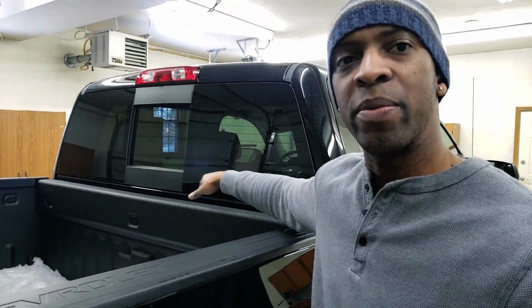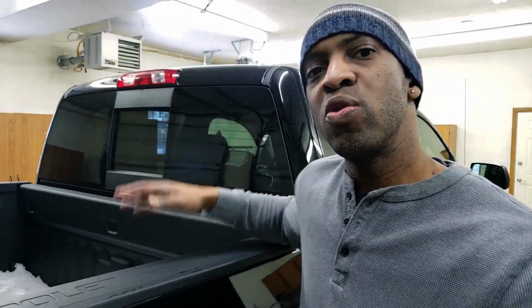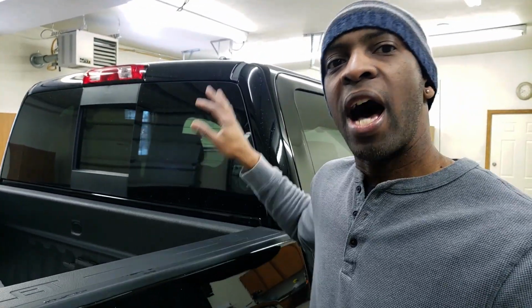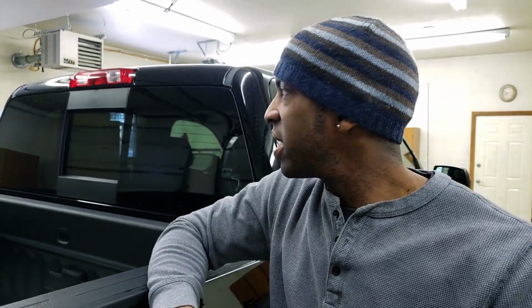But now I'm finding out a lot of the flat glass windows, the solid back truck windows, I used to shrink a lot of those. But I started thinking to myself, you know what, let's just try to throw them in there and see if I don't need to shrink. Now, I'm gonna tell you that shrinking will help tighten up the bottom, but a lot of newer trucks too, I'm a hand cutter, so I'll cut the design out, I'll lay it on there, I'll hard cut it out, and then it might be a few fingers in there, but then when I put it inside, I usually can get those fingers to lay down. So some of these back truck solid glasses, you might not need to shrink either.